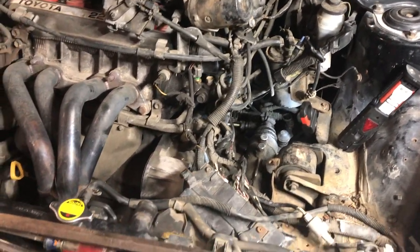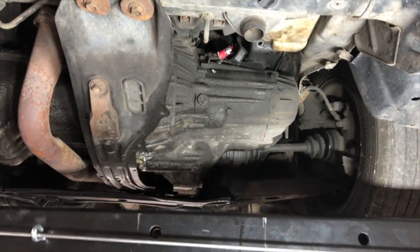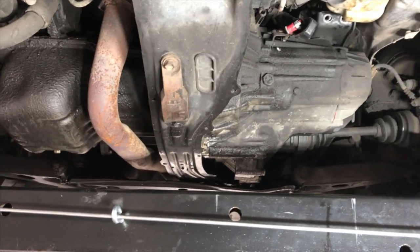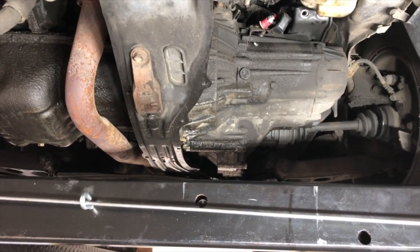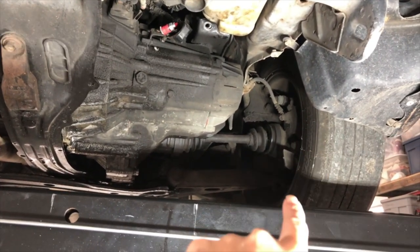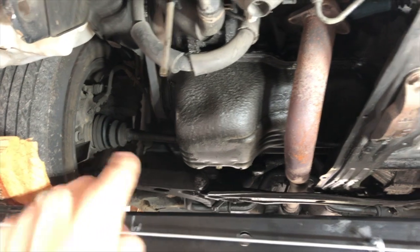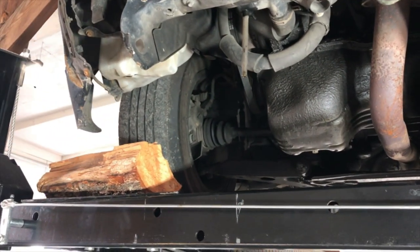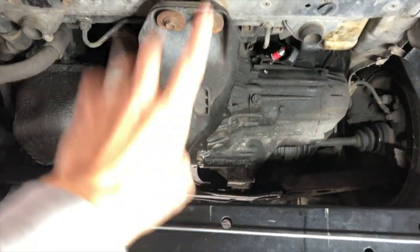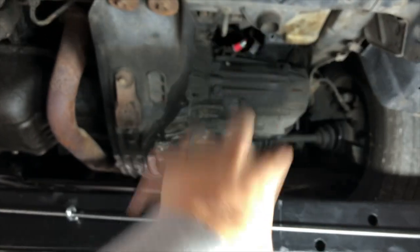What we're doing next is making sure I've got as many of the bolts out of this bell housing as possible that I can reach — I'm probably going to have to lower the car to do that. We have to take off the wheels and get these CV axles out, get this cross member out, and disconnect all the mounts. After we get that done and get these axles out, the transmission will be ready to drop.